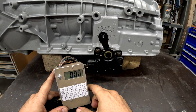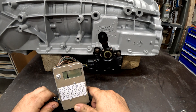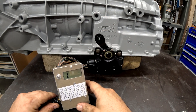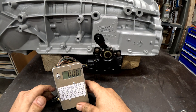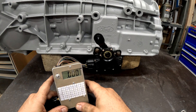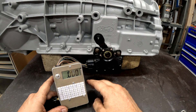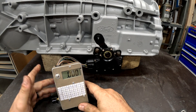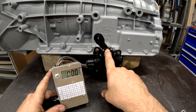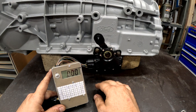Manual 2: 2-3 should be closed, 2-4 should be open, 2-5 should be closed, and the rest open. Manual 1: 2-3 closed, 9-11 open, 2-6 closed, 2-5 open, 2-4 open, 2-3 closed. So this one is good to go. It's a Ford Motorcraft one, definitely reusable. I always go with Motorcraft when I have one. When they're brand new they tend to last a long time — it's really just a matter of these O-rings holding up, keeping moisture, oil, and water out of that switch inside.